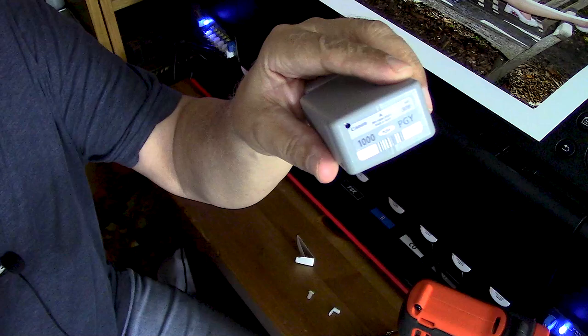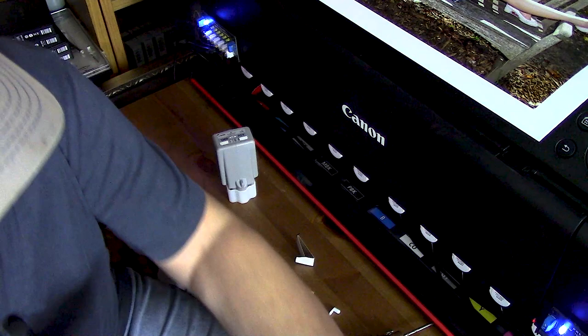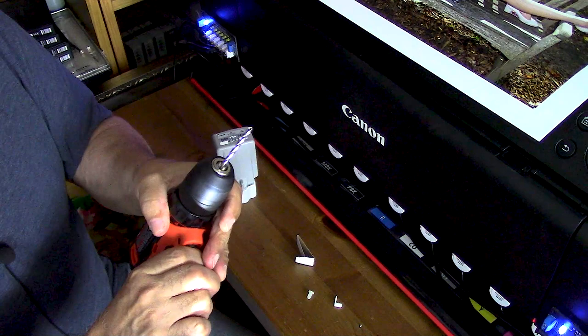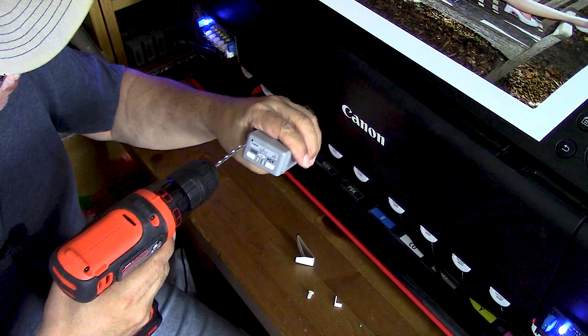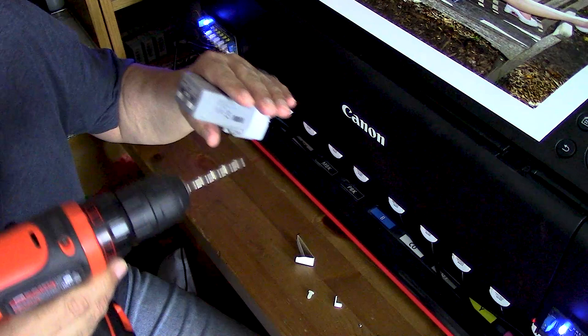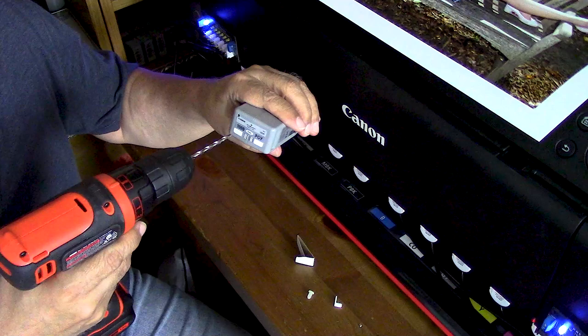So now we will install the final drill, which is the 5/32 of an inch drill. Put this aside, bring my, there it is. Make sure that you have it nice and centered. Spin it, it's spinning through, no wobbles. We'll repeat the same thing. It's gonna be a lot easier this time because we've already created a smaller hole. So even if that hole had been slightly inaccurate, it doesn't really matter because now we're gonna true it up with the 5/32 inch drill. If you do this from the beginning with just a 5/32 inch drill and you make a mistake, it's too late. That's it. So start with a smaller drill diameter and then proceed with the final drill size.